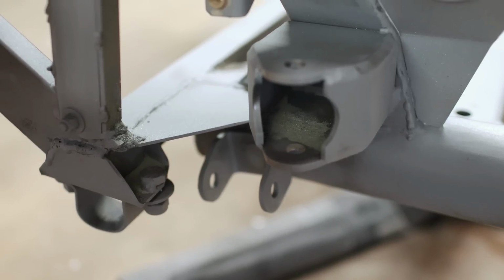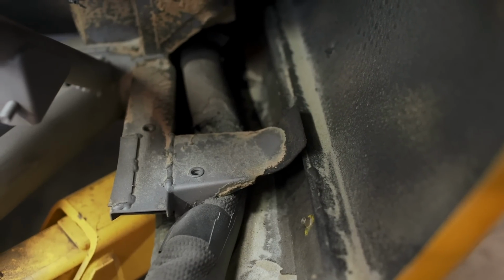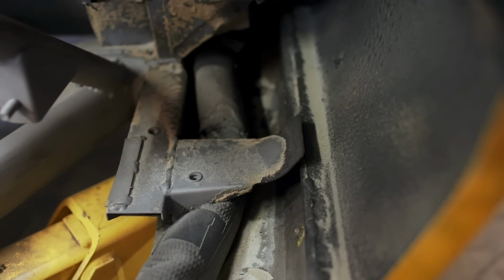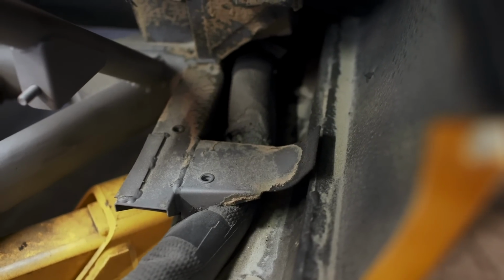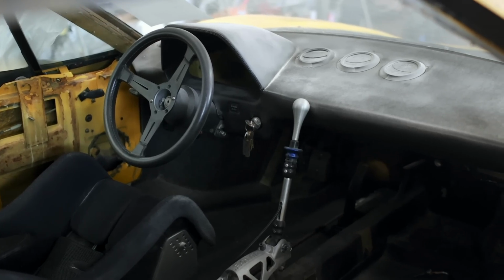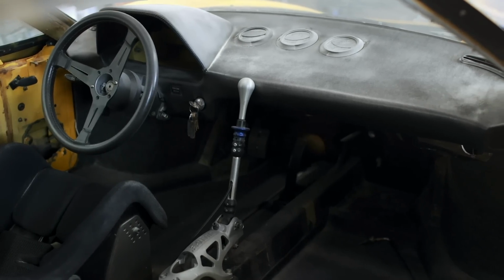A lot of you guys expressed concerns about this, instead suggesting that I go with dry ice blasting, but dry ice blasting wouldn't actually remove the finish from the chassis, it would just clean it up. So the unfortunate reality is, now we've got to deal with sand everywhere, including inside of the car. Anywhere this sand could find a hole or a crevice, it went.